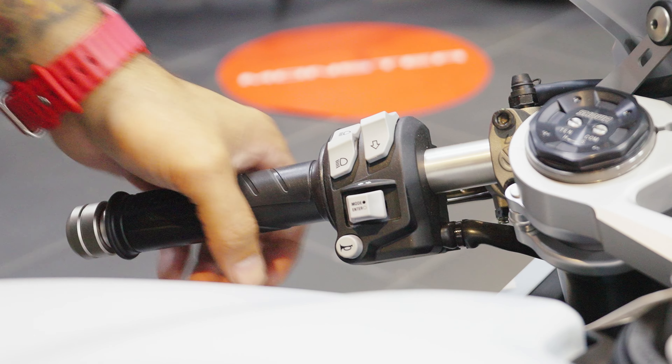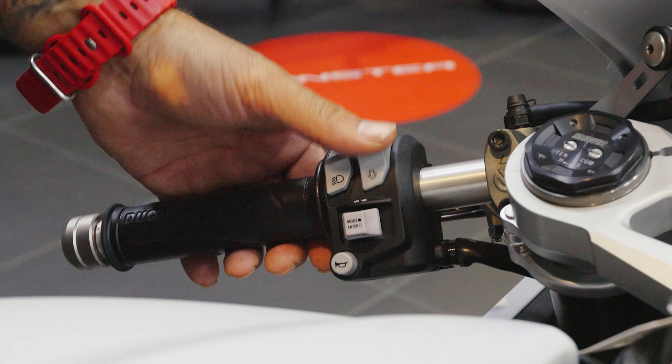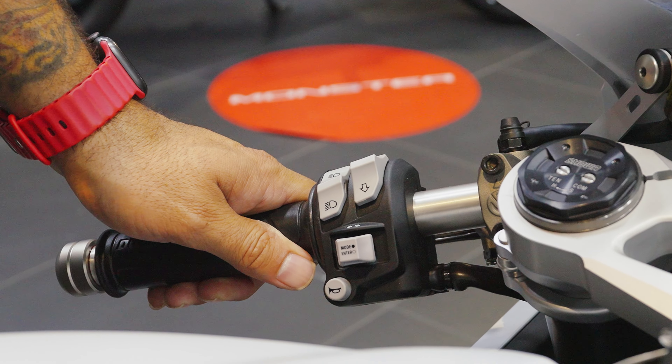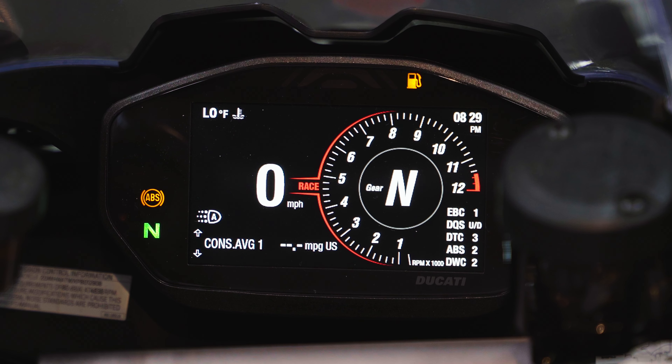Make sure you are looking at your owner's manual. For navigating the dash I'll be using two buttons: up/down, and enter. On the dash, there are a bunch of flashing lights when the bike is stationary — your ABS and traction control lights blink because there's no motion, but as soon as you start rolling those turn off. You've got a neutral light on the bottom left and in the middle of the tachometer, a fuel reserve light, and on the right side of the dash the oil light is on because the engine isn't running and no oil pressure is sensed.